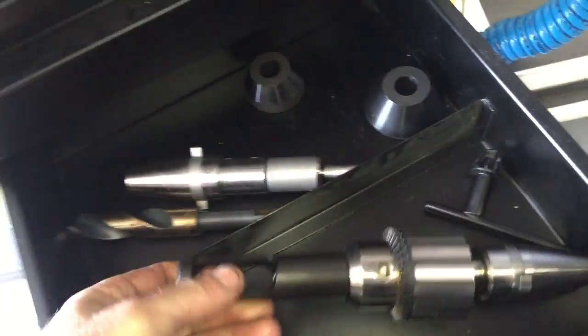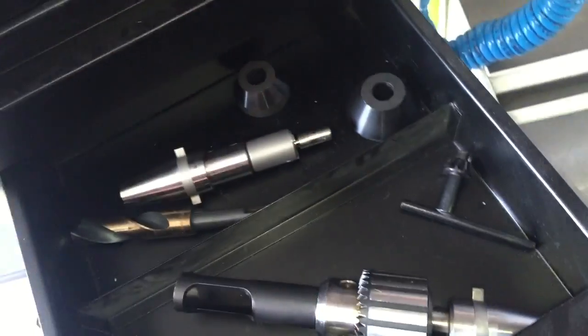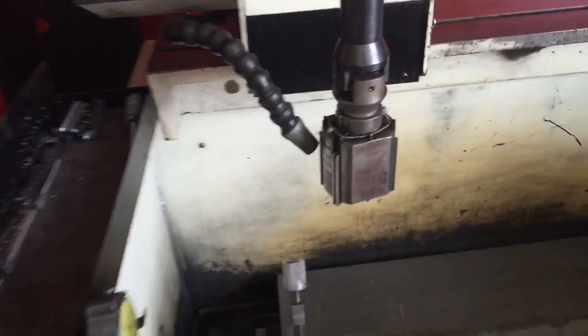For cutting the seat pockets, I'm gonna use this right here. Throw the springs on, no big deal. Right there to cut the counterbore, to cut the guide top, once we machine for a guide. And then over here, obviously I've got the stones in.